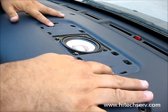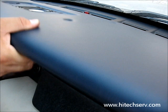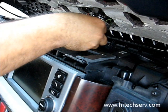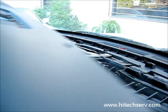You're going to have two screws here, and then six screws all around this cover — remove all the screws. Once you've taken all the screws out, gently pull it up like this. There's only one plug holding this — that's for the speaker on top. Once you pop this out, you can see on the bottom — that's the one for the speaker. Once you take this, disconnect the speaker and pull it out.